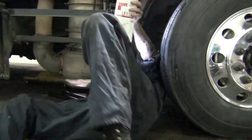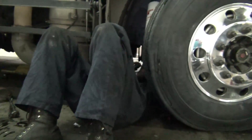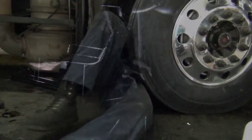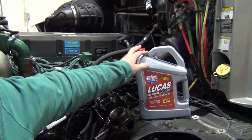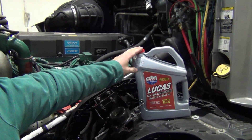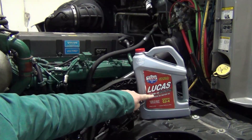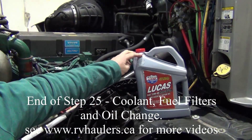The engine oil has been drained, the oil filters have been pulled off with much swearing, new ones put on, and now we're going to replace the oil with 100% synthetic. Here's what we're going to be using for the engine oil fill — Lucas makes a good synthetic product and it's a 15W-40, of course for use in a diesel engine.